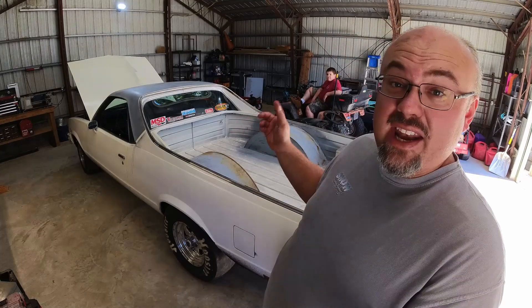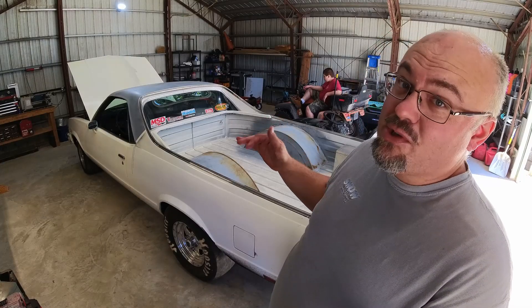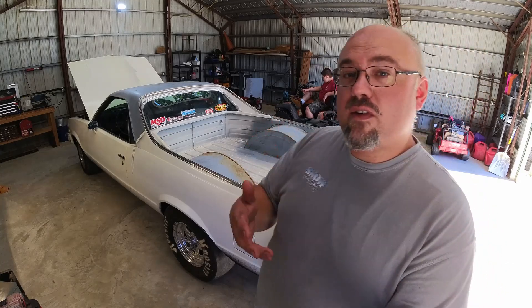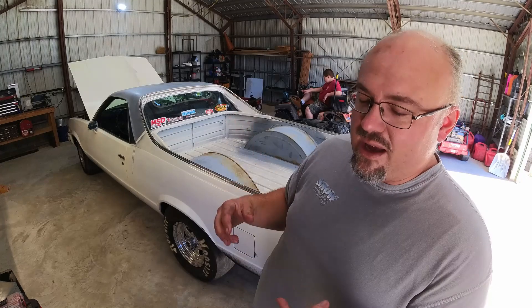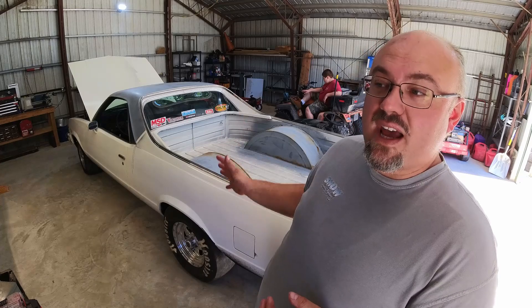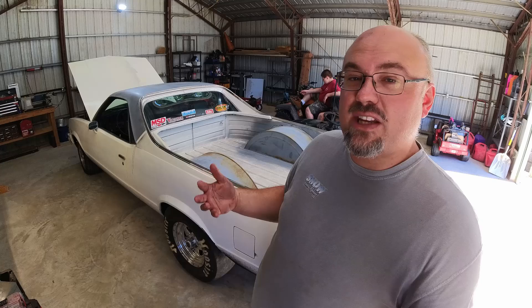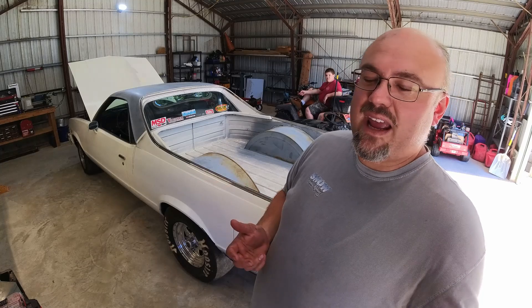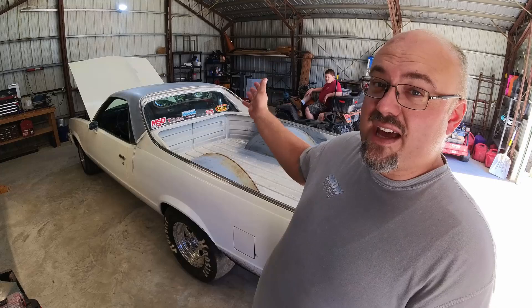That right there is one reason why I stepped up the rear end of this car. It was howling, and now I can see why — I had one tooth that was nearly gone, and I'm sure there were others about to go. This has got a 12-bolt under it now, but that doesn't mean it's perfect in every way. You've got options: there are a lot of kits doing 8.8 Ford conversions, you can put a 9-inch under these, or 12-bolts if you can find them. There are a lot of rear-end options to get more strength out of the back of these cars. That 7.5-inch 10-bolt served me well, and if you need to step up your game, you certainly can. Thanks for watching — let's get out to the garage and go build something.